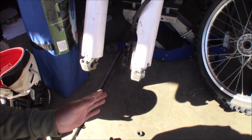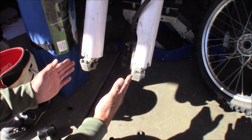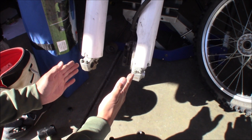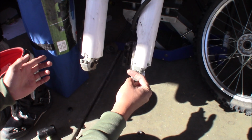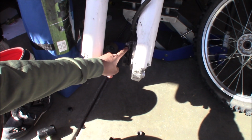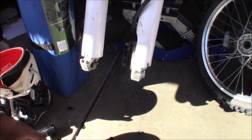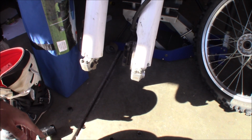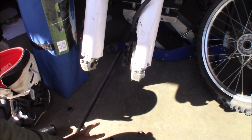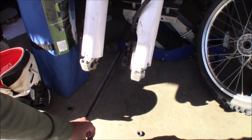If it's longer than the other one, it would push the rotor further to the left, from where we're looking. And that's where the rotor is grinding right now on this bracket. That's why there's a lot of drag on it, and why the rotor's all eaten up. So I believe they flip-flop these, because you can put them on any side, is what I just found out.